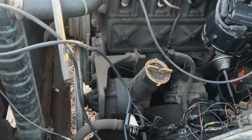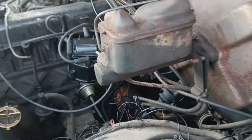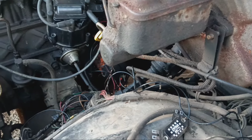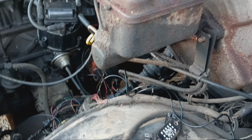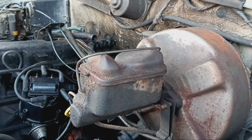Well, if it's hissing, don't. It might be the ignition module. I don't know. Where's the ignition module at? Inside the distributor. Oh. Yeah, but if the coil is bad... The coil is getting power. So that's cheaper, so that's why I'm thinking that one first.